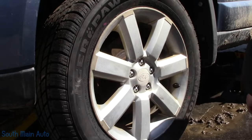Hey, hey, hey. What do you say? That's all that's left of that nut. She's pretty thin. Hopefully those threads are still usable for us. Got a puller that goes on here. Astro makes it, but it requires the use of the threads. Get a pickle fork before we bust it out of there. We can see if we can get that bolt out.